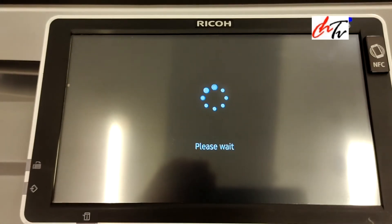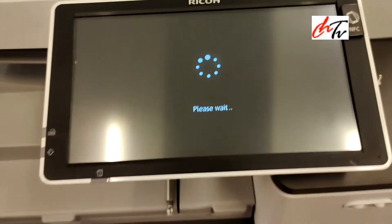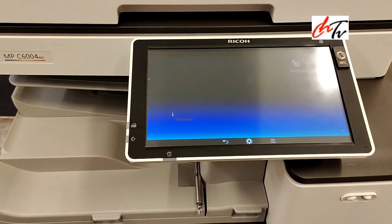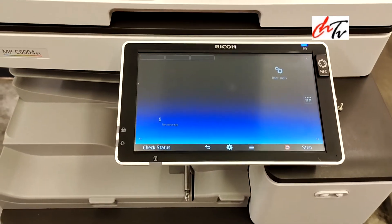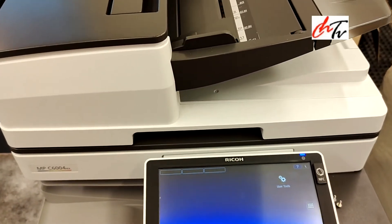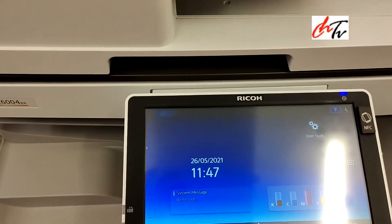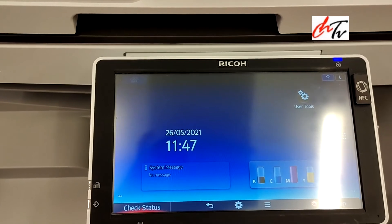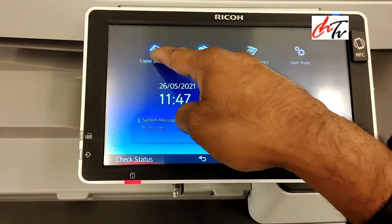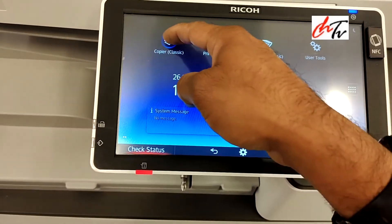So here we go — we power down. That seems okay. If the problem is still there it will start kicking again with the SC24003 error, but it's not. You can make sure by printing a counter page or test chart.